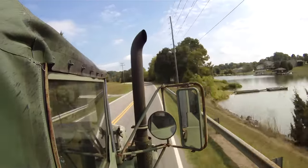Important note, if your truck is moving, make sure you use the clutch when you're going from low to high speed or vice versa in your transfer case. Now, if you're sitting stationary, your truck's either shut off or you're in neutral, then you can go back and forth without touching the clutch at all, because the clutch doesn't actually have anything to do with the transfer case itself.